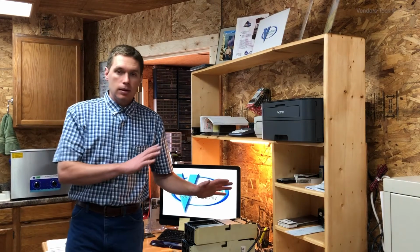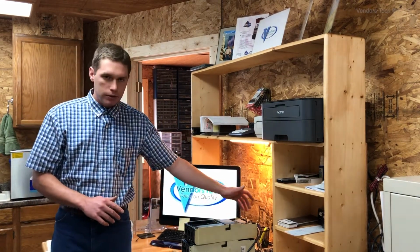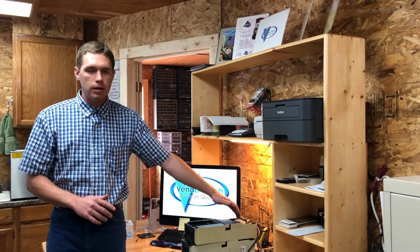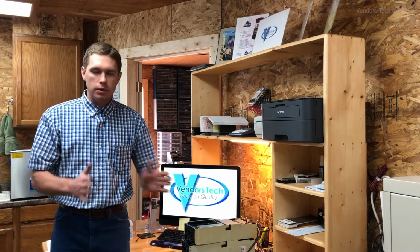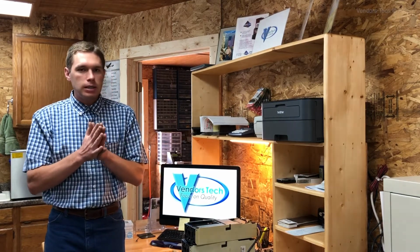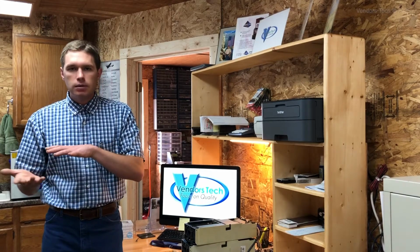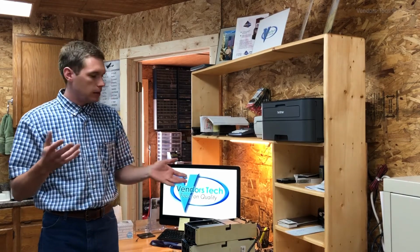These have to be handled very carefully, for reasons like the ceramic issues I'm talking about with the coils in here that create the magnetic field for the coins. These are very, very fragile pieces of equipment, and the newer coin mechs are too. These have to be handled gently. If you're carrying them in your truck, they need to be on your seat with nothing else beneath them, nothing else hard bouncing against them. It needs the full cushioning of a seat to travel safely without being wrapped in something else.